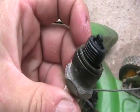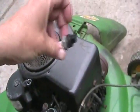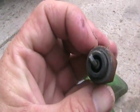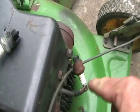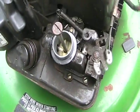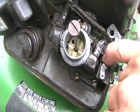Remove the spark plug and check its condition. If it looks like the one I just took out of this mower, don't use it — it's probably shorted. It can be really old and still perfectly good, as long as it's not fouled. Now check for spark: put the wire on, set the base on something metal, and rotate it so you can see the gap. Make sure the machine's turned on — it's on when the metal isn't touching that little kill tab that goes to the magneto.